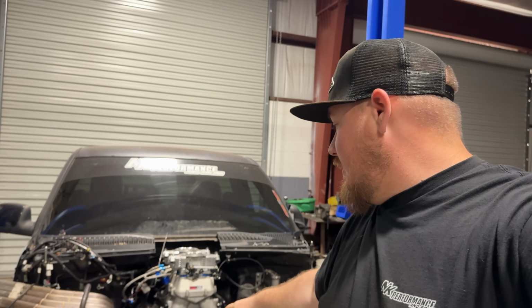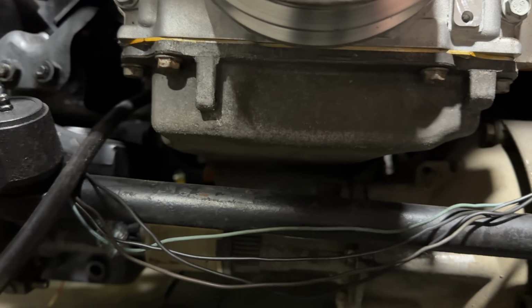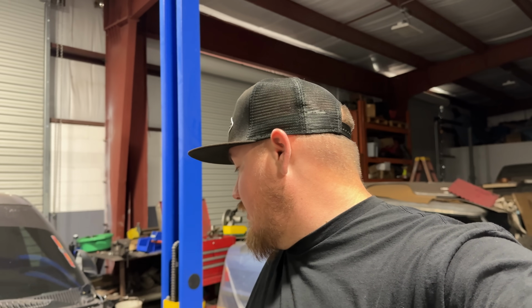I actually have his solid motor mounts on this that are an inch lower, which, by the way, barely clears. But it does clear if you have an all-wheel drive truck and you're curious. They do clear. So we will get those cut off. I'm gonna find out about the control arms. He does make a kit, so you can actually use those and the factory lowers and kind of just bolt them on, basically. Cut those off, clean everything up, weld those on, and then the other ones just kind of bolt onto the bottom so you can coil over the front of your truck.